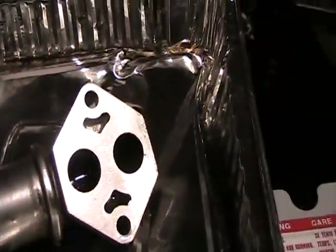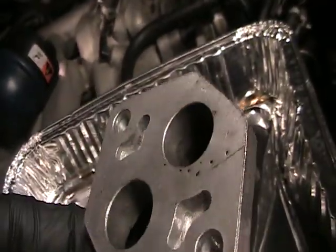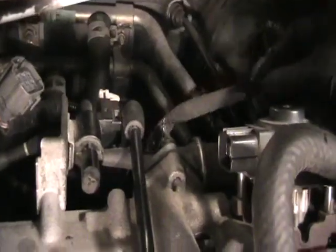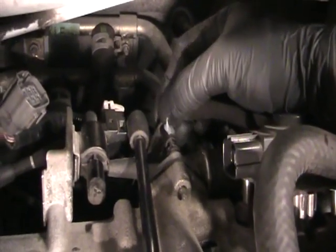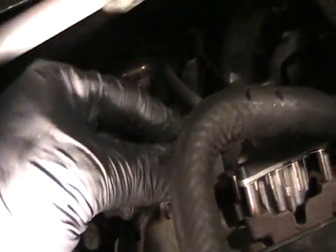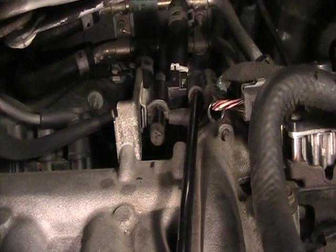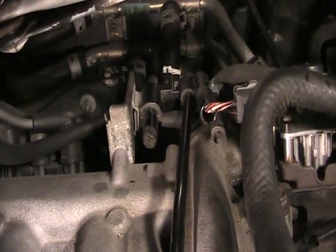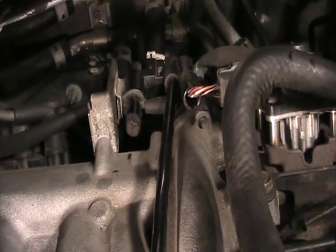So that's about all you can do — fill it up with carburetor cleaner and swish it around. You can see it's black coming out so it's gunked up a little bit. It's kind of hard to get in there and do much. I put it back in, plug it back in, and I'm going to put the EGR valve back as well. So I cleaned it out — I'll take it for a test drive. Good maintenance — do this once in a while. If it doesn't fix it, I'll just put a new one in.